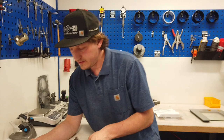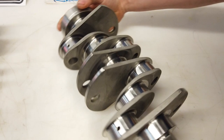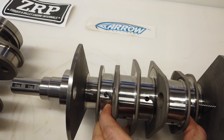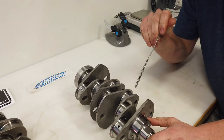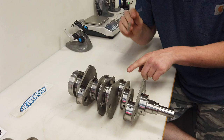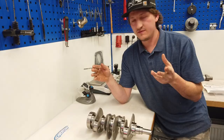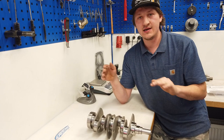So, yes. Then you see here this hole. It goes through this, here, like this. Can you see it? Yeah. That means here is a complete channel, like this. And the main bearings 2, 3 and 4 send the oil pressure to big end bearings 1, 2, 3, and 4. It means you have very constant oil pressure on the big end bearings and in the complete crankshaft. That is pretty good against any trouble with oil pressure or bearing problems or something like this.